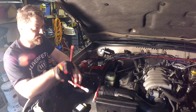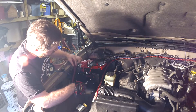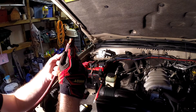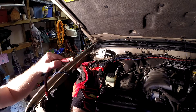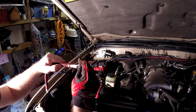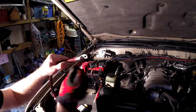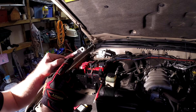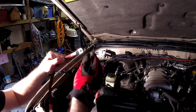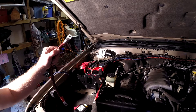I crimped this on, so now I'm going to do this other end. This is going to go from the switch up to the fuse up here. One of the things I like to do when sealing these up with the shrink wrap is make sure that there's some exposed area here. Because that shrink wrap — the glue in it — is going to seal around the wire and around the connector and hold it together. But if you don't have that little bit exposed, I kind of worry that you might get a little moisture in there, and that's what's going to cause that copper to oxidize and over time cause resistance and problems.